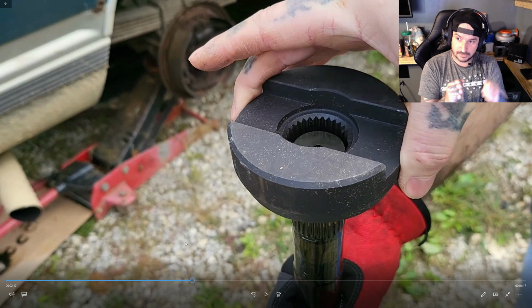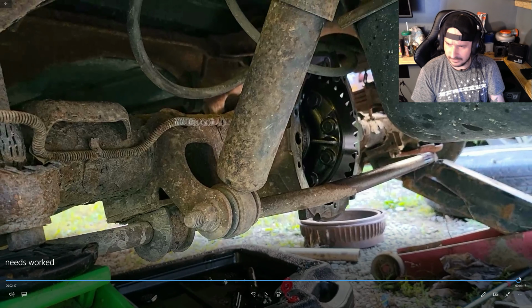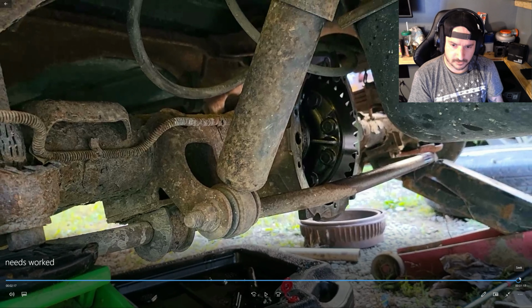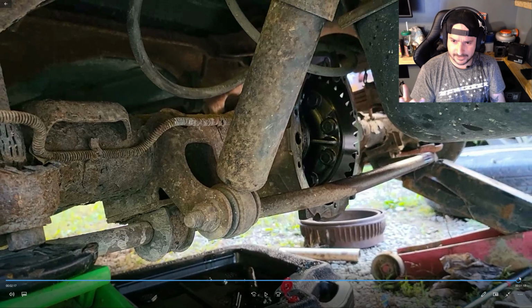But once you get them in, they fit kind of tight, then your pin goes through them, and what they do, the little squares, they lock both axles in place. And your pin goes through it, and you put your bolt back in it. Then you assemble everything. This is a GM 10 bolt. Holds 2.7 quarts of fluid if you need that information. We put 3 quarts in it, till it runs out of the fill hole usually.